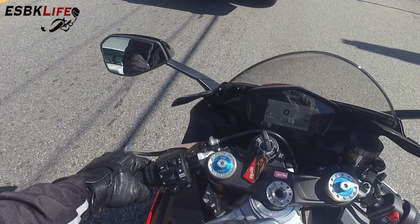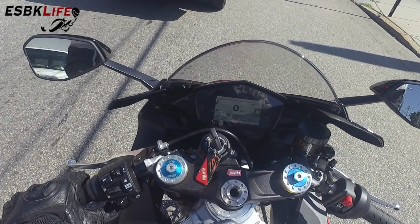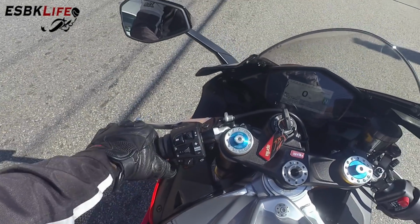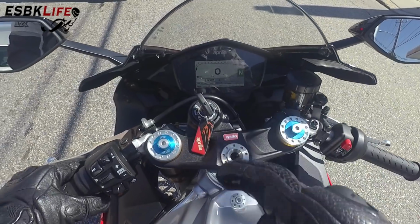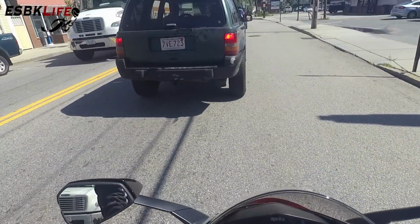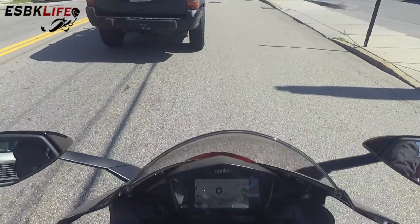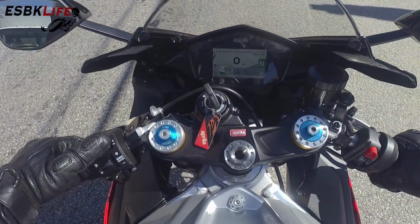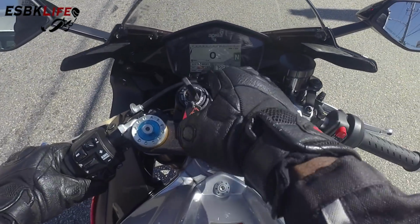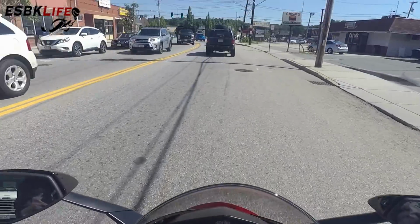So you can adjust items on the fly, just like the previous RSV4. I have it set up for traction control, so I can adjust traction control on the fly by just hitting these thumb buttons. There's a minus one here and a plus one here, so I can go up, plus 3, plus 4, I can come down. Using this joystick, we can toggle through, so I've got an ABS setting there. If I push it, I can then adjust ABS. Here's wheelie control. If I push it, it flashes, turns red, and now I can adjust it. Oh, green light. Sorry, can't adjust it right now.